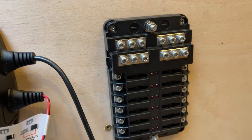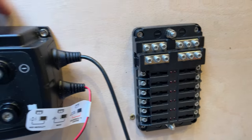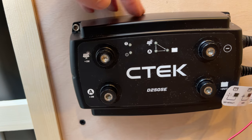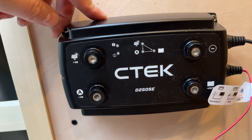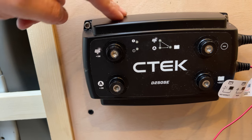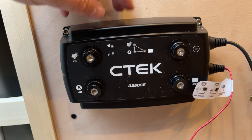This is a 12-blade fuse holder, so I can wire up 12 different appliances to this. I'll tell you why I chose the CTEK — I could have gotten away with a split charge relay because this doesn't have a smart alternator, however the CTEK is really simple to wire up and it allows me to plumb a solar panel straight into it as well. It's a little bit more expensive but easier to fit.